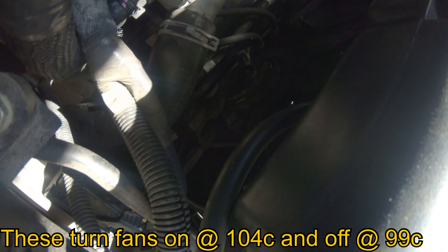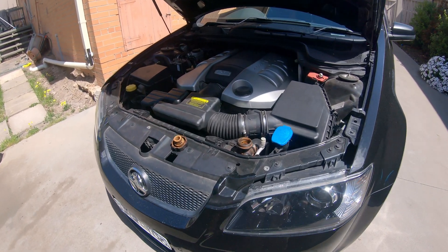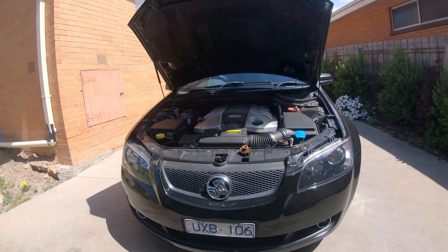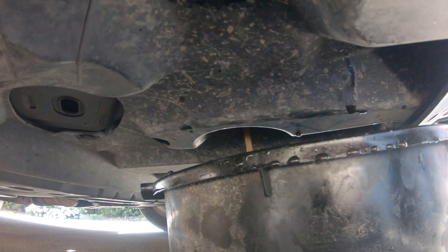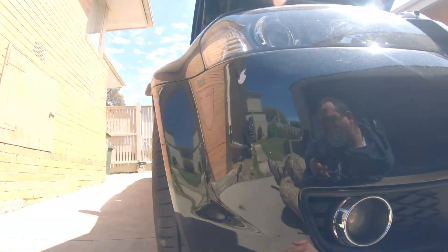The car's cooled down enough, so let's undo the drain plug and drain out this coolant flushing solution. I've lost count of how many times I've actually done that and re-flushed this thing through. Each time I seem to be getting rusty, dirty water coming out, but it gets less and less bad each time. So I don't know when to stop — I could be here all bloody day.